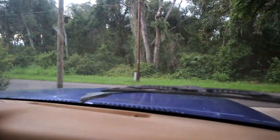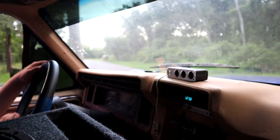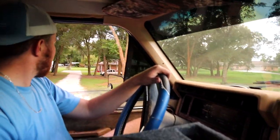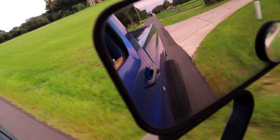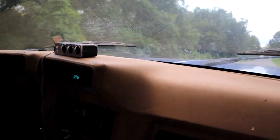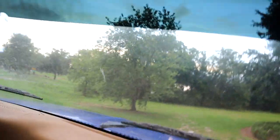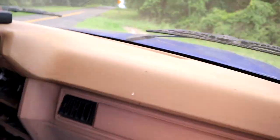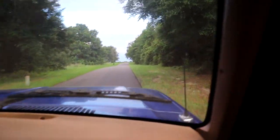It stops — pretty good. I made sure it stopped better than before. You can tell there are no shocks in here? Yeah, you could tell. That might be why it's bouncing like that — it's just a coil spring with no damping.